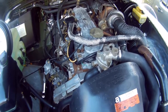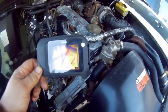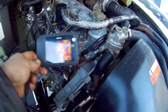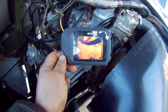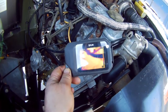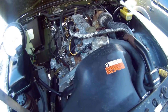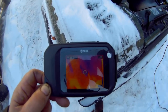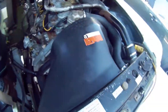You know how sometimes time flies and you get sidetracked. Well now it's about three and a quarter hours since this block heater has been on. Let's have a look at it — 18 degrees. You can see how the heat rises at the bottom of the block and rises progressively as we get towards the top — 17 degrees. I don't think you really need much more than that, this should start up without any problem. The ambient temperature is still minus 17. So that's going to be good, I think we're good to go and start.